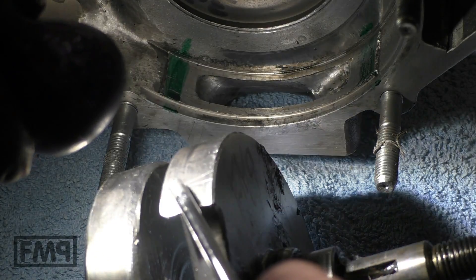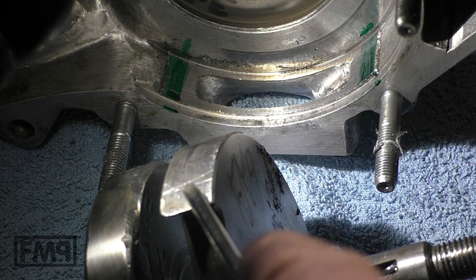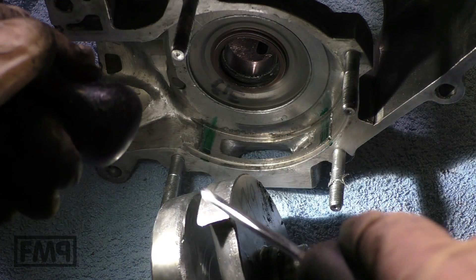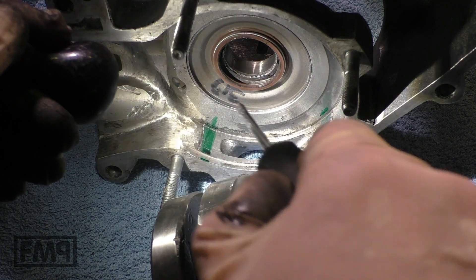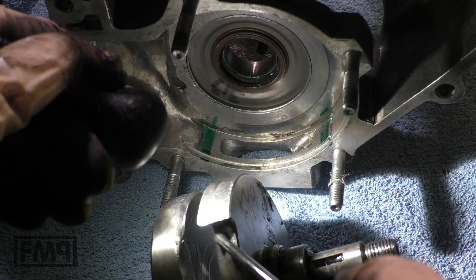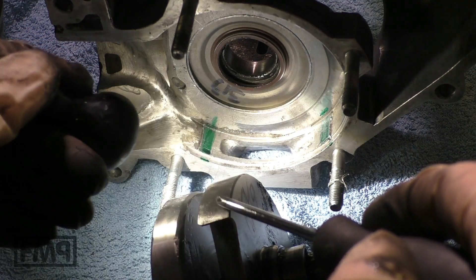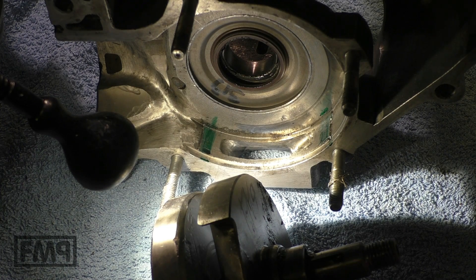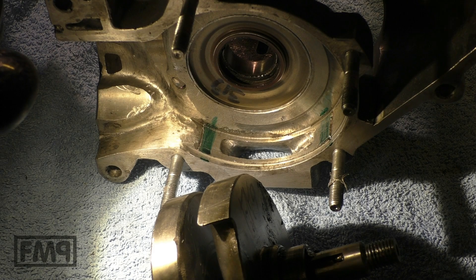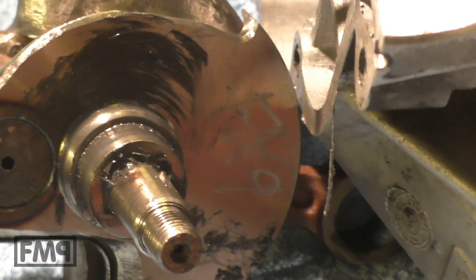The professionals are turning out this area, centered over the bearing seat — turning out this welded and raised area to the set value of 0.05mm. So you turn it out, then you stop, take it out, measure it, put the crankshaft in, measure it again, and restart — as long as you get the needed 0.05mm, or let's say less than 0.1mm. This is the set value all original engines have from the Piaggio factory, and this is of course the needed base for a tuning project.